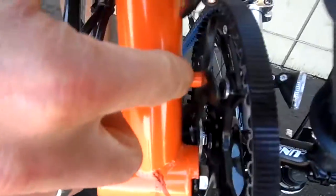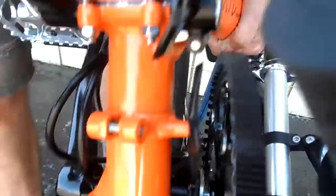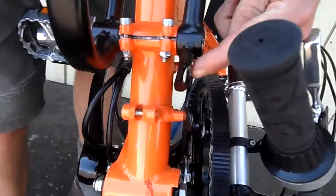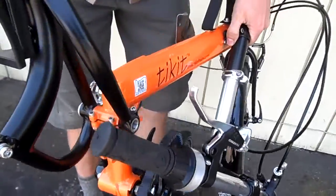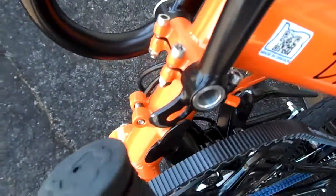What's happened is this peg has latched into the hole in this latch plate and it will not release until the seat mast is pivoted back up towards the riding position, and what we call the sweeper will lift the latch plate off of the latch peg. So that's the fold — it clicks in place right there and then the sweeper lifts the latch plate off of the latch peg.